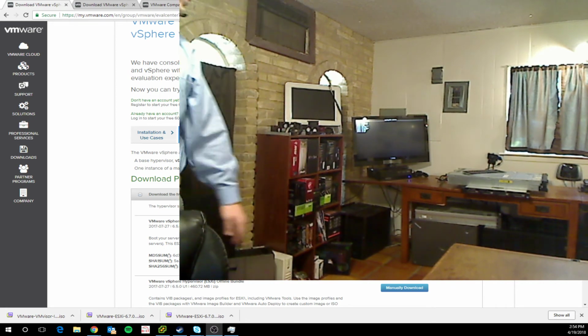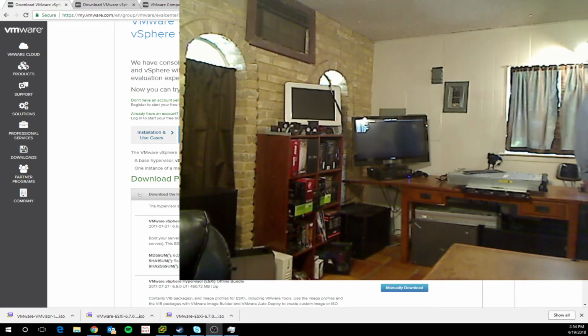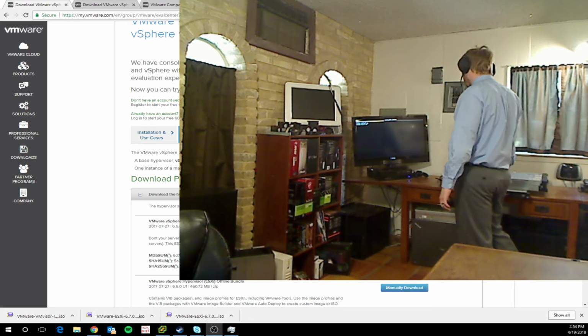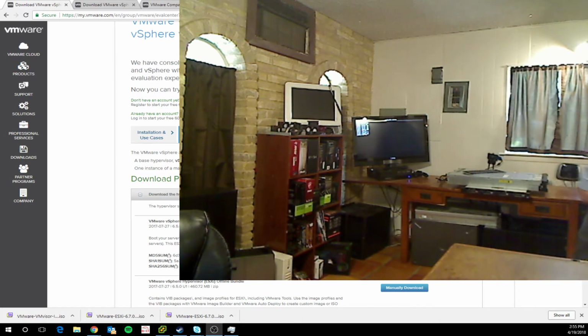Joe, I'm actually loading ESXi 6.7 on an IBM x3650 M4. And I actually just got done installing 6.5 U1 on an R410. It was giving me a CPU support error saying that this CPU no longer was going to be supported. So I'm interested to see if that same support error gets thrown on the IBM, or if it is supported, or what it even meant by that support error.